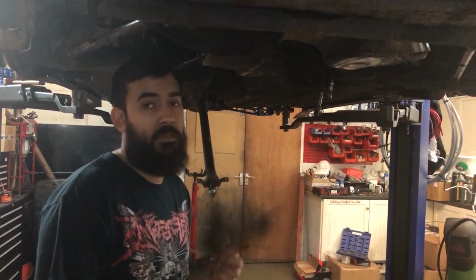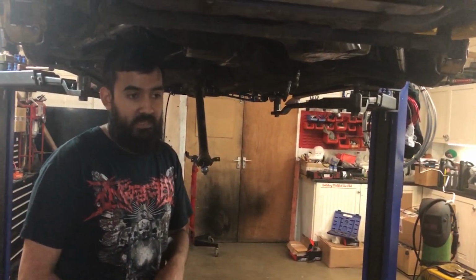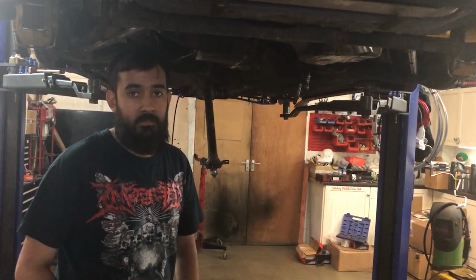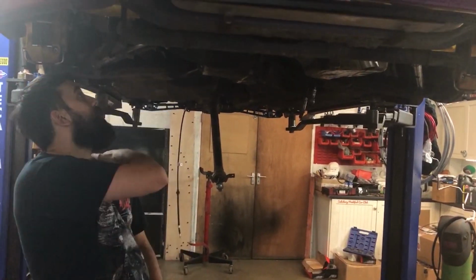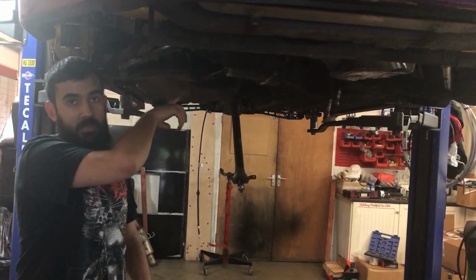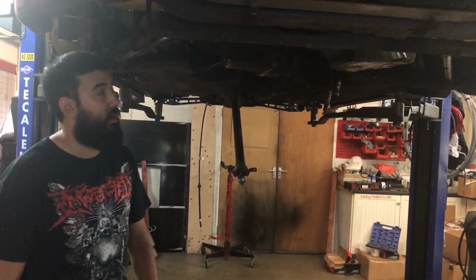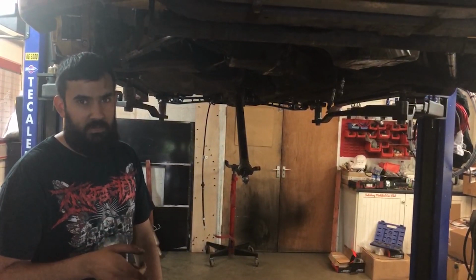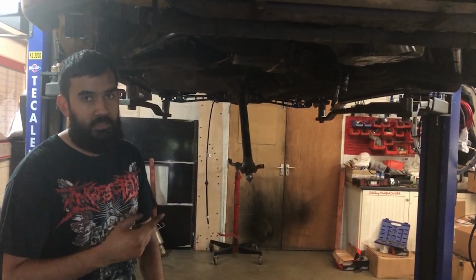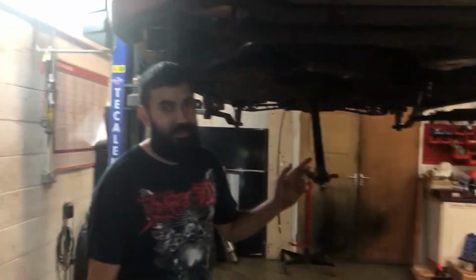So we've got the K-Tuned cables that are down there, the hybrid shifter going in. We have tested it, it all does work. So if anyone needs to know what to use in their B-series all-wheel drive, the K-Tuned up there, we've got a billet K-Tuned B to K cable conversion. So you can use that with, I think they're K-series cables and a CL9 shifter. We do have hybrid shifters on the website, in case anybody wants to know.